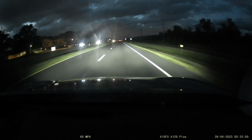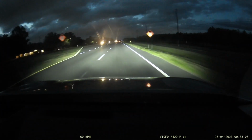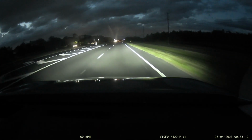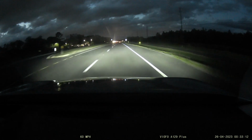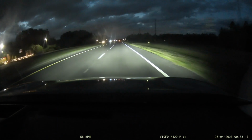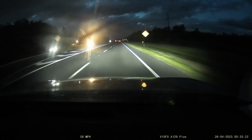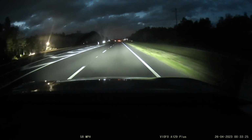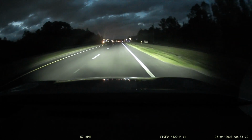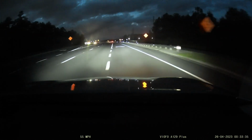And of course, this has emergency impact protection, so if you ever do get in a crash, it will auto lock whatever event is going on. And both the normal impact detection and parking mode impact detection have separate sensitivities. That's important. I've had some dash cams that just had an on-off toggle, and it was ridiculously annoying because it would constantly be going off like you got in an accident if you just went over a bump or a speed bump or even braked really hard. So it's always good to have that adjustability.